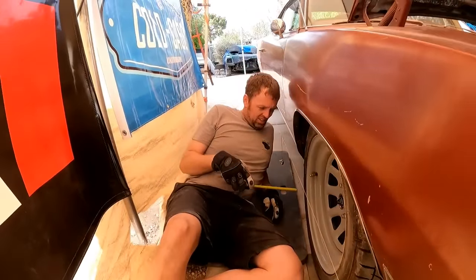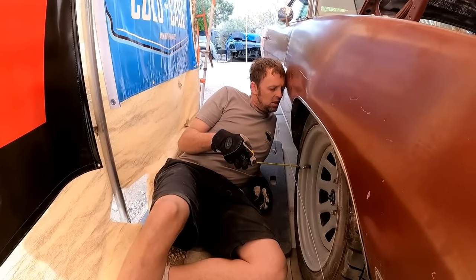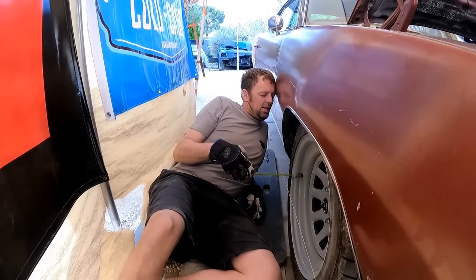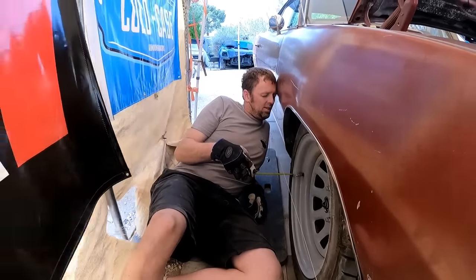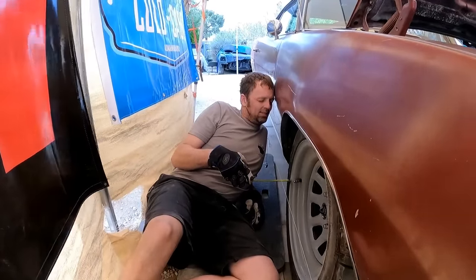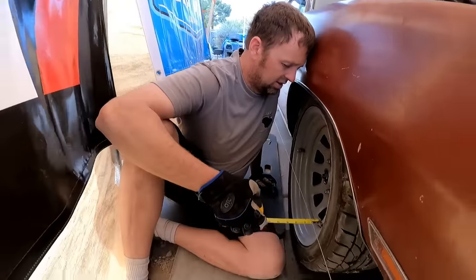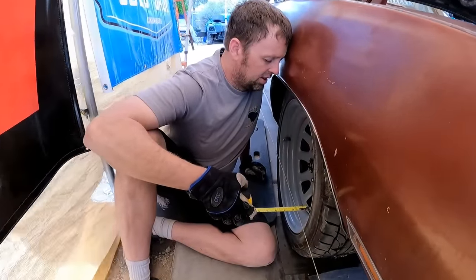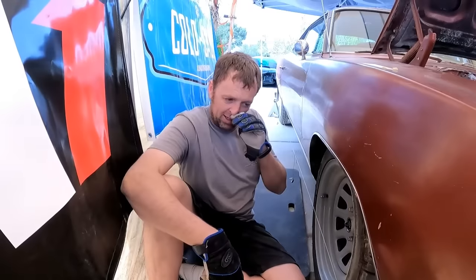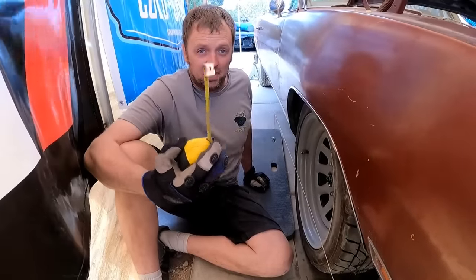So I just got done adjusting it. Now I have pretty much right at, it's 1¾ inches, or no, I would say it's like 1 11/16". And this is just to the inside of 1¾". So I would say this is about a 32nd toe in, which is what I want, because a 32nd and a 32nd is a 1/16 of an inch.